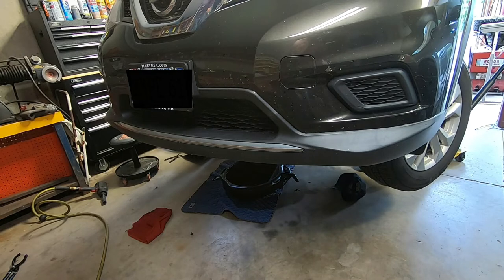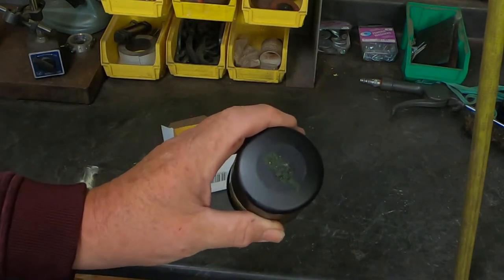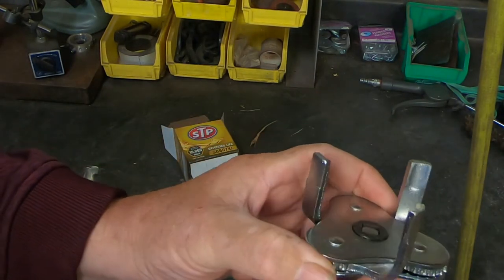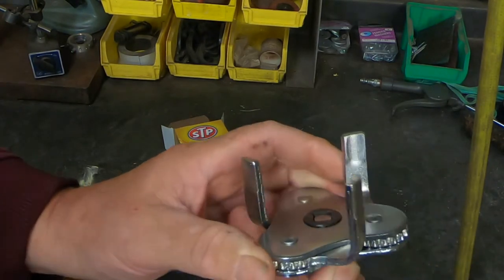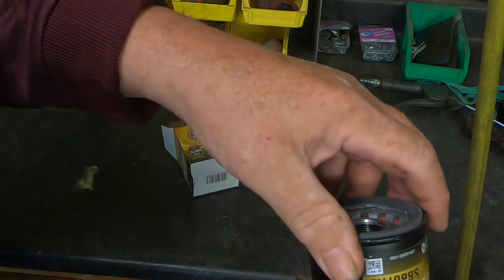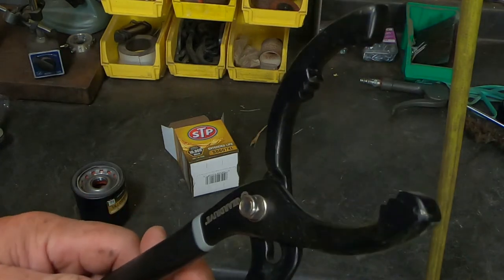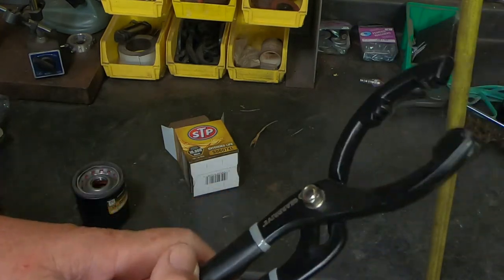The socket I used to install it is just stripping around the outside of the filter. So the purpose of today's video is getting that stuck filter off. This is the new filter I'm going to be installing, and I've already tried a couple of things to get the old filter off. This chain-style device — as you try to loosen the filter, these prongs tighten around it and the more you turn it the tighter it gets — but the filter is too small so that isn't going to work. I also tried filter pliers but I'm not strong enough to really get a good grip to turn them; they just keep slipping.